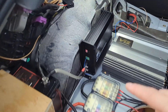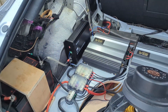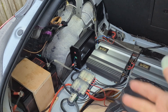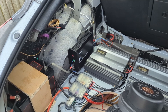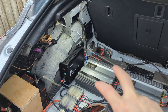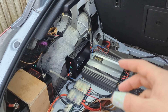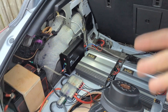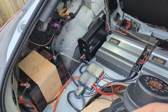There's a sense wire that turns on the DC-DC charger. The proper solution would be to go directly into the alternator, as the manual says, but it's very tricky to get there. So my plan is to put this wire on a voltage-sensing circuit or a timed relay — for example, a 2-minute timer so that when I turn on the ignition, after 2 minutes of driving the DC-DC charger kicks in.